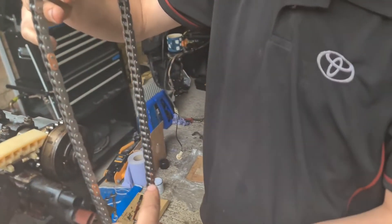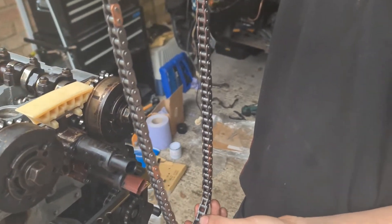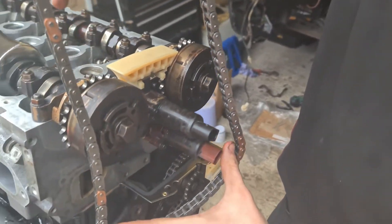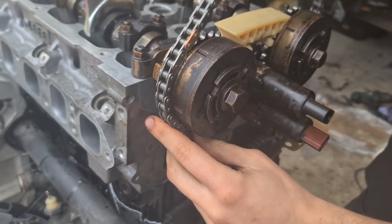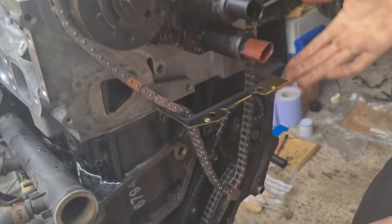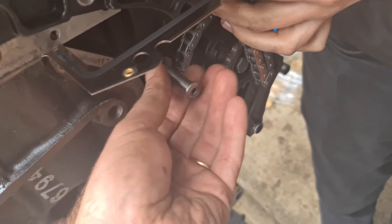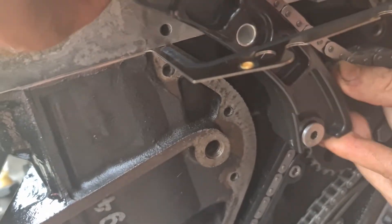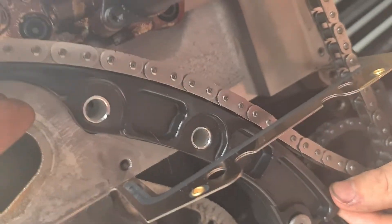I've got these copper links here. You want these three links going around this intermediate sprocket, and the other links on those sprockets. The best way to do it is just to drape it through the open head gasket there — otherwise you're just going to be fighting with it and you can end up damaging the head gasket itself. Make sure you've got the guide on the top there as well. Put this into this hole, get it so it's almost finger tight, and then you can put the guide and slot it all over like that — just so it's not going to go anywhere, and that gives you a lot more room to set the guide in.